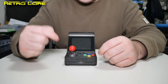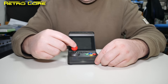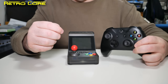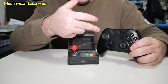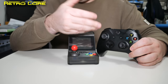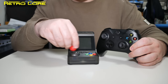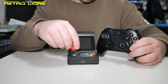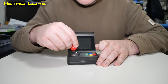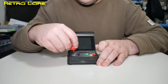Talking about the analog stick — somebody in the comments mentioned that I don't know what an analog stick is. This is an analog stick and it acts in a digital fashion, as most of us know. Just like a modern controller, this is an analog stick, but when you control the menus on the front end of the machine it acts as a digital controller just like a D-pad does. So that also means you've got a bit of a dead zone in the center, because it doesn't actually register the move until it reaches pretty much the end of the travel, which is a bit of a shame.